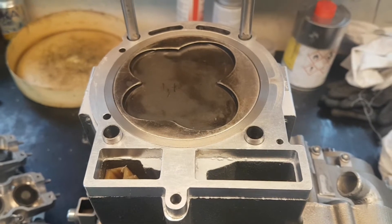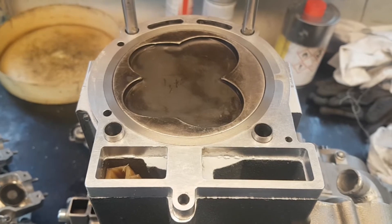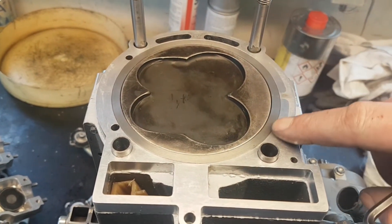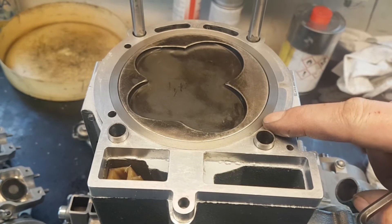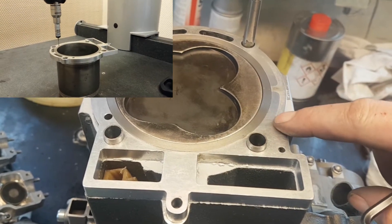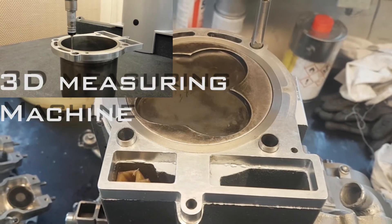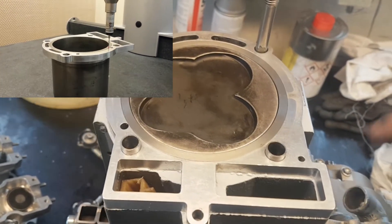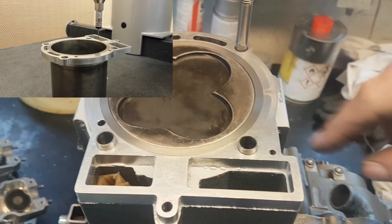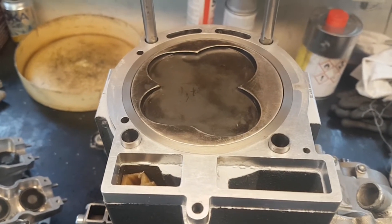When using a copper head gasket and reusing it on a water-cooled engine, it is extremely important that all surfaces are exactly the same height. Even small differences — like two or three hundredths of a millimeter — could be enough for it not to seal. So I have done a lot of work on this and also the corresponding surface on the head, to make it absolutely square and of the same height all over.